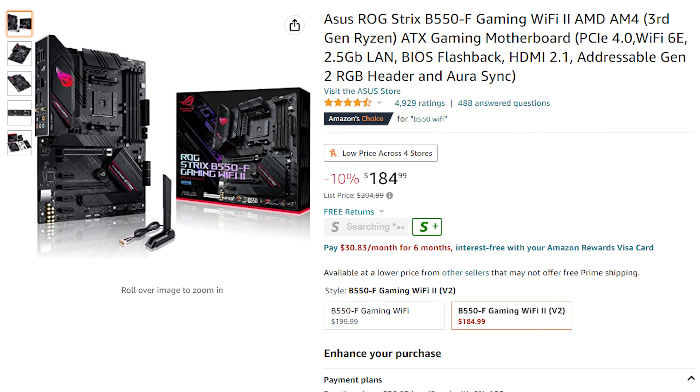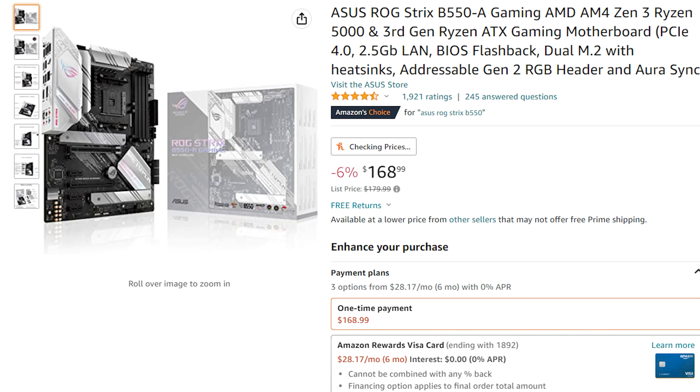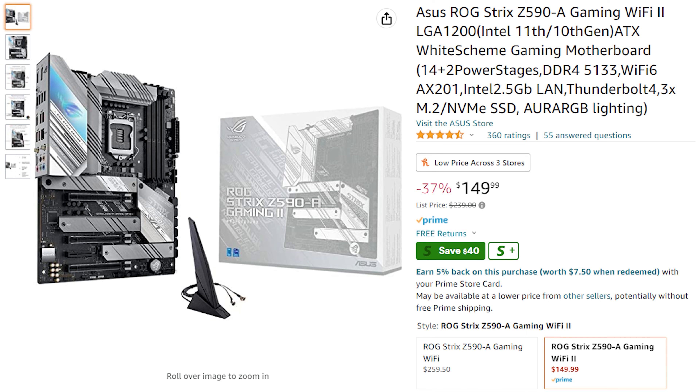Now it's time to figure out which motherboard you want, so you can buy your CPU and RAM based on it. Almost all gaming motherboards have RGB these days, and ASUS is a solid choice for both reliability and great SignalRGB support, including the RGB headers. If you're on a budget, go with previous-generation motherboards, and you can save even more by skipping WiFi. For those with a deeper wallet, you can spend more to overclock, but cheaper motherboards offer plenty of performance. I'm going with a two-year-old ASUS ROG Strix Z590A, which I got brand new for only $150 — cheaper than the RGB fans.